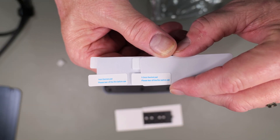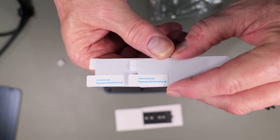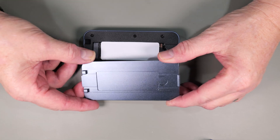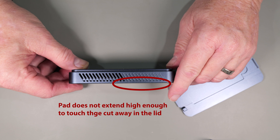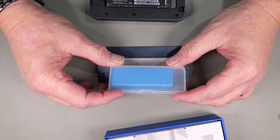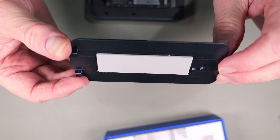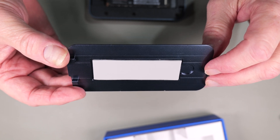I did want to point out a minor issue I ran into with the thermal pads. Depending on the drive you're using, you may need to make sure you're using the right thickness. It comes with two pads — a 0.5mm and a 1mm — but I found that both were too thin to make actual contact with the lid. Even stacking them to get 1.5mm was still too thin. There is a small cutout in the lid for thicker drives, but this makes it more challenging with a drive like the 990 Pro. To get sufficient contact I had to use a 2mm thermal pad, which doesn't come with the device. These pads are inexpensive and I'd suggest getting one in advance. I'll leave a link to the pad I used in the description.